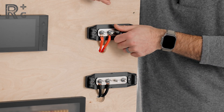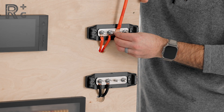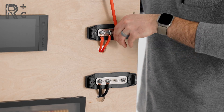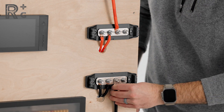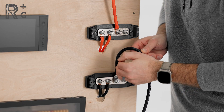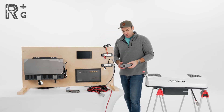For this RTX install, we're going to take off the third lug for both the negative and positive bus bars — this is where we'll be attaching our power cable. We're going to have an 80-amp inline fuse going on the positive side before we make our connection. We'll tighten this down just hand-tight for now, and the negative will attach directly to the bus bar. We'll route this so it's coming out the top for consistency.